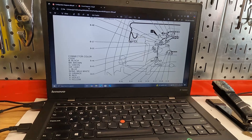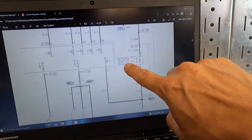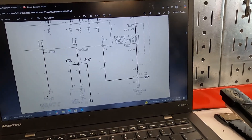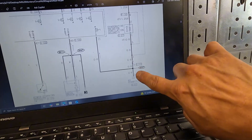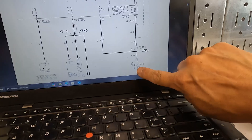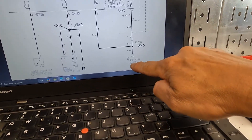B57. So if you go to the wiring diagram and look at the EVAP emissions vent solenoid, the trigger wire has a green with a red stripe, and it has a splice point that goes to connector B57. It says 'no connection' at B57 — that's how I figured out that this connector is connected to the EVAP vent solenoid.